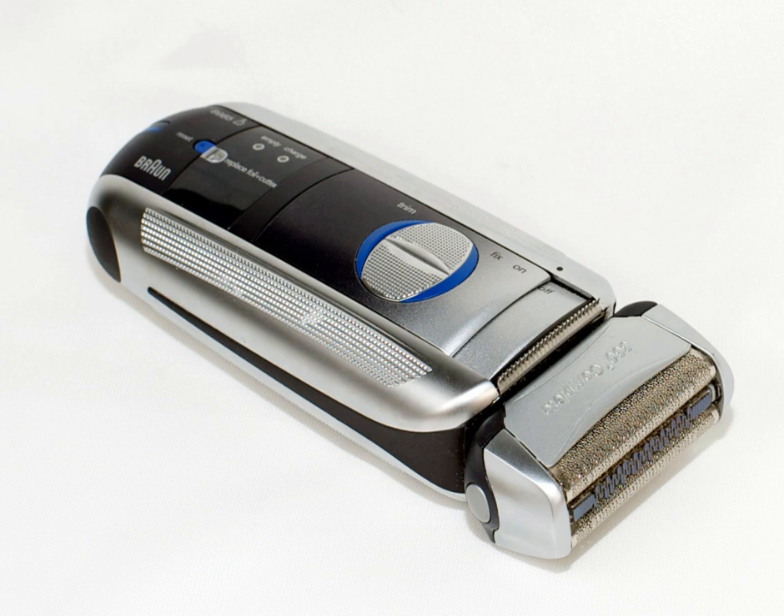Since at least the mid-1960s, battery-operated electric razors have been available using rechargeable batteries sealed inside the razor's case, previously nickel cadmium or, more recently, nickel metal hydride. Some modern shavers use lithium-ion batteries that do not suffer from memory effect. Sealed battery shavers either have built-in or external charging devices. Some shavers may be designed to plug directly into a wall outlet with a swing-out or pop-up plug, or have a detachable AC cord. Other shavers have recharging base units that plug into an AC outlet and provide DC power at the base contacts, eliminating the need for the AC to DC converter to be inside the razor, reducing the risk of electric shock.